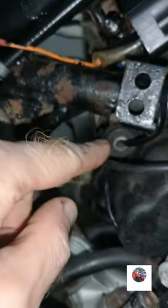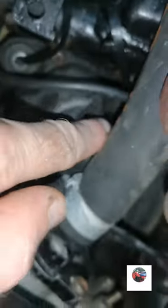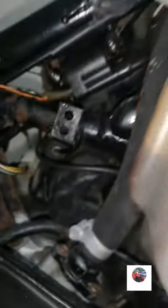Get the exhaust off. Turn the key. See where the power valve's sitting in here. When you turn the key, I might have to disconnect it. So we get these brackets. It's going to need two brackets welded on there and this power valve motor fixed on properly, because like I see, it's just wobbling there. Might just have to pin it open, but we'll get the exhaust off now.